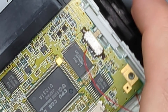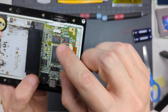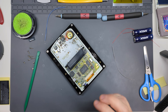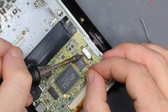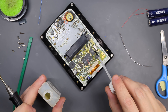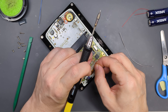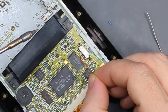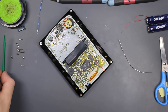A gentle tug just to check — it has worked and is secured in place. It doesn't look like a very tidy joint, so I'll show you how to de-solder and re-solder if that's bothering you. To de-solder, all you do is be ready on the wire to move it out of the way, heat the point you were soldering to, and move it away. To re-solder and get it to flow better, I pop a little bit of liquid flux on the surface and on the tip of the wire. Then the process is exactly the same — clean the tip, heat the blob, allow the wire to merge with it, and move away. This time it's flowed into a much neater blob. And it's given me the chance to show you how to de-solder as well.